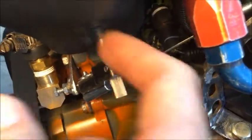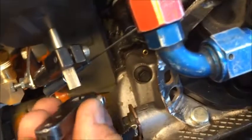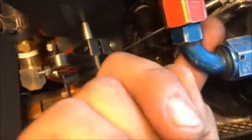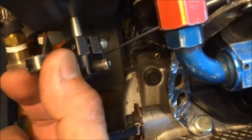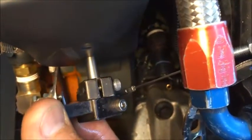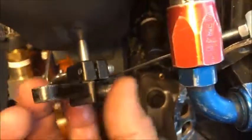There's a pretty good spring in there, but if you want a second spring you can always add a second arm like this and put a spring between here and the arm — there's another hole down here. Before you do that you need to get in there and cut off the little black arm on one of the wheels. You can leave the rest of the white gear in there. There's just a little black arm you cut off and it makes the throttle return all the way to closed. These arms are a little over $7 on eBay.